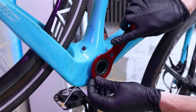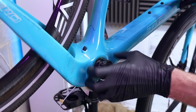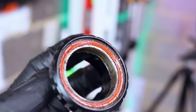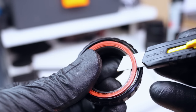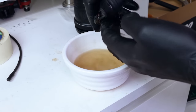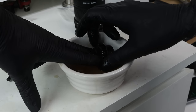These type of bottom brackets are generally not serviceable, but that's never stopped me. I pried off the plastic cap to find the bearing — which is press-fit into an aluminium cup — covered in rust. I peeled off the bearing seal, gave it a good rinse with isopropyl alcohol, loads of crud fell out, it got a little smoother, so I dried it out, repacked it with grease, and stuck it back on the bike.